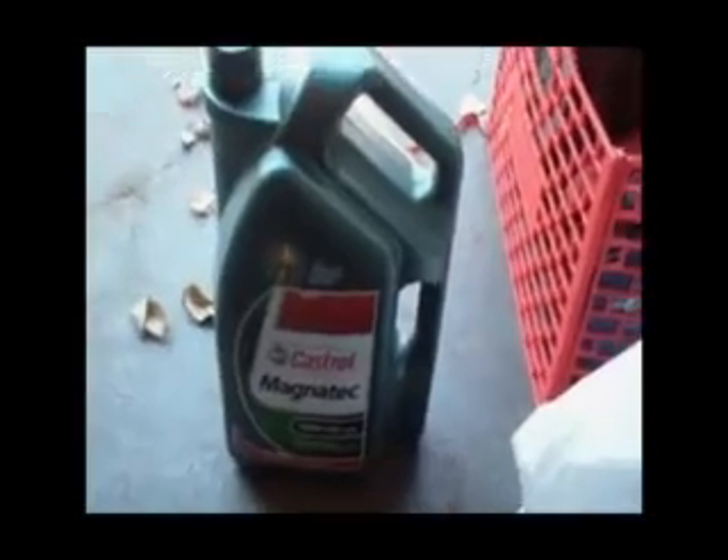I'm going to perform a very basic service on the bike today. This is our speedo cable running through place. I'll do that when the bike gets assembled. Got a plug, got our oil filter and of course the oil. I prefer to use 10W40 for the climate here in South Africa. It's the best for me.